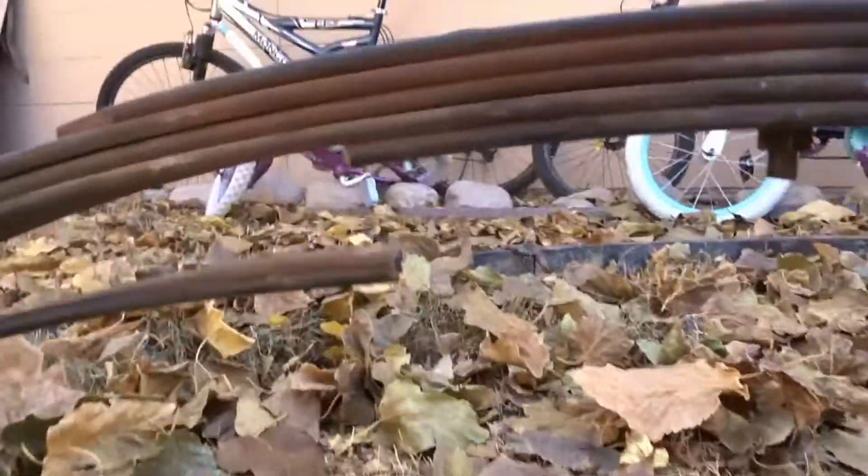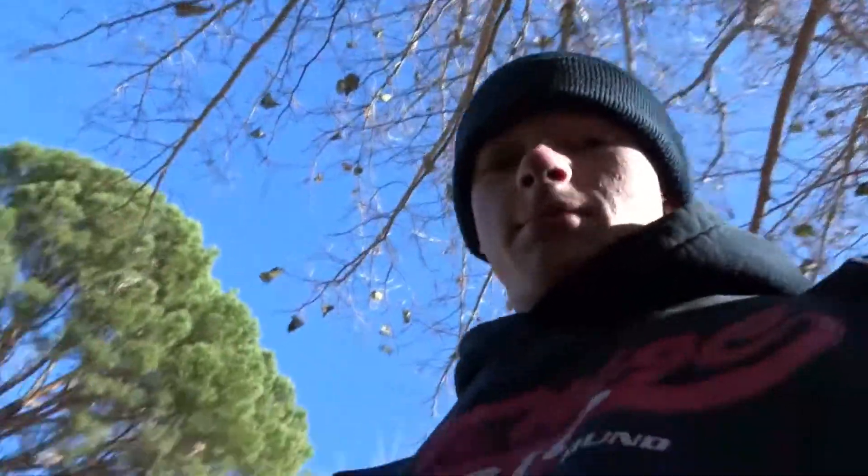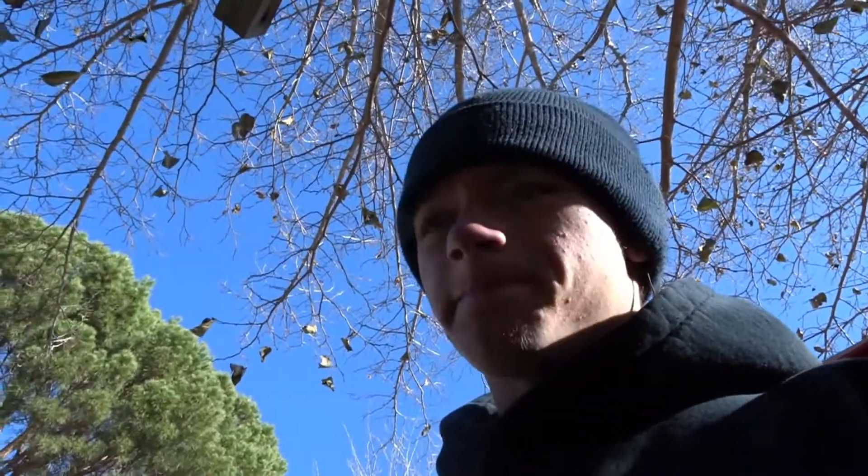Alrighty, so I got it all bolted back up — the leaf springs are all bolted. If you're wondering what I'm doing to the Samurai exactly, or why my leaf springs were ever untightened in the first place — my dad with the big blue Jeep that you've probably seen before was at this off-roading event called the Chili Challenge and broke a leaf spring. He thought my Samurai springs would fit because they're Wrangler springs, but his are longer and lift springs, so they didn't fit. He just did a temporary fix so he could run one more trail, and that's why they were off.